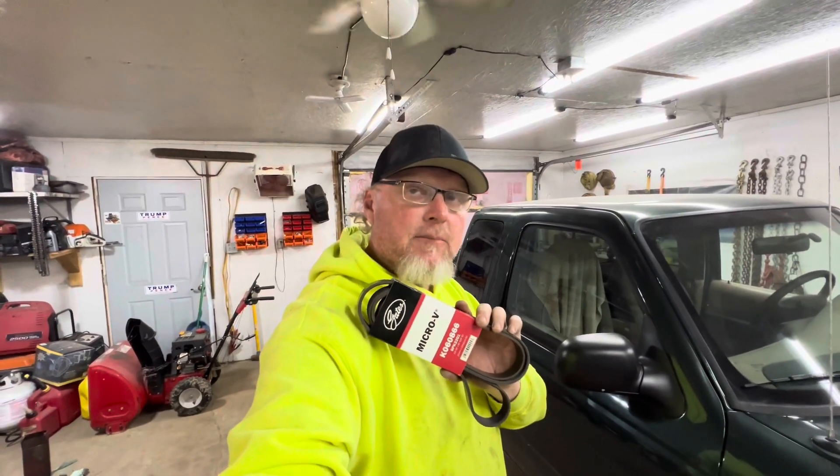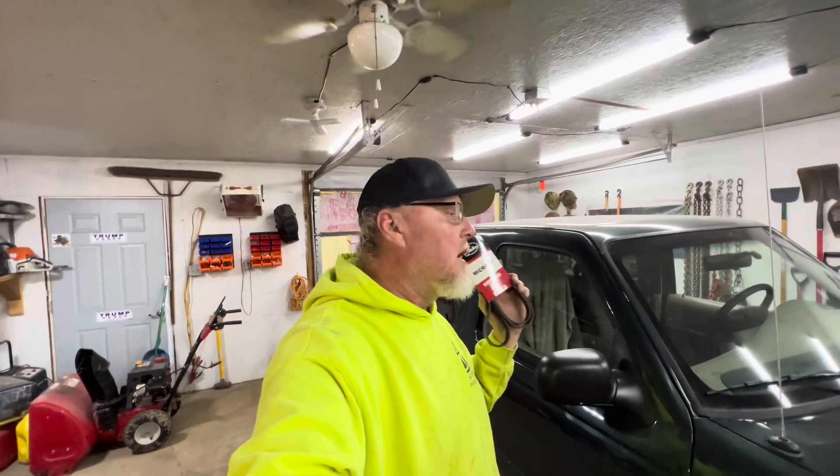Everything is riding in the ribs — that's what we want, and I don't hear any more noise. Now the belt is replaced. What I'm going to do with the old belt is put it back into the sleeve that the new one came in — it keeps it wrapped up and tells me what belt I need if I break another one. I'm also going to put the tool I made in with the jack. Thanks for watching — if this helped, give me a thumbs up and maybe subscribe. Safe motoring, be good.